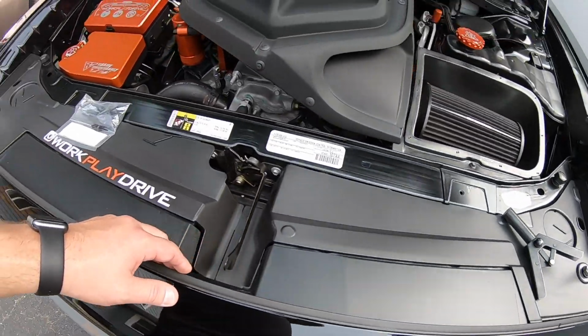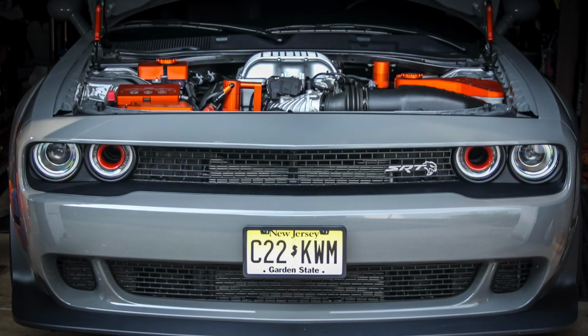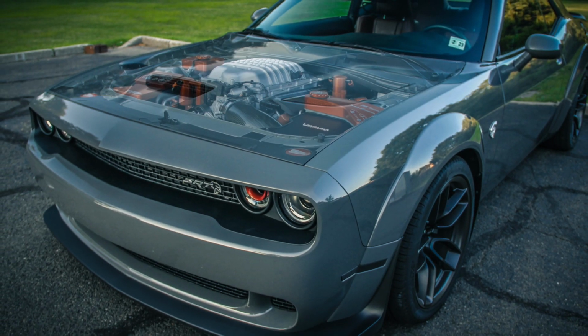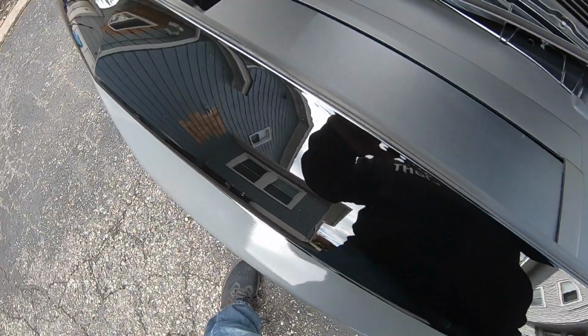It's not totally necessary, but if you're like me and love a clean engine bay, it's totally worth the 45 bucks in parts and 1 hour it takes to replace. If your hood seal is starting to crack, I would order one and have it on standby. If it's separated and flapping on the hood while you drive, I recommend ripping it off right away to prevent damage to your paint.